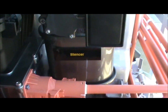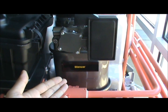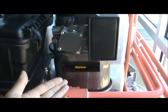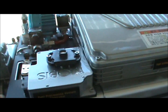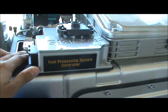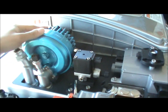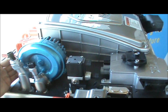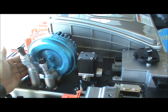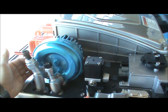So we have installed a muffler here, or we call it the silencer. It reduces the amount of noise generated by the blower significantly, so the vehicle can be much quieter when you drive. Now for the fuel processing system: this controller controls the speed of our recirculation blower for hydrogen. That blower ensures hydrogen is supplied at a uniform concentration throughout the fuel cell stack, which is a key role in maintaining the stack at a longer lifetime.